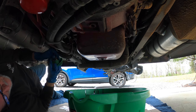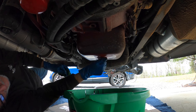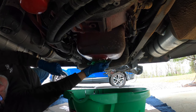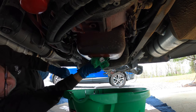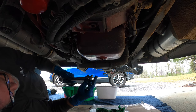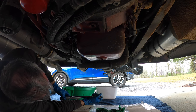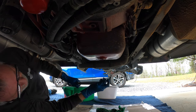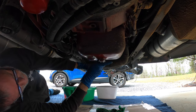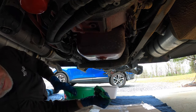So we're down to a drip — I think it's good enough. I'll wipe this off real quick and then get our plug back in. Just remember, you don't have to crank these down super tight. I think the book says around 35 pounds, but definitely don't want to overcrank it and end up stripping your oil plug — that would be a bad thing.